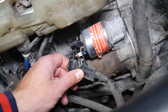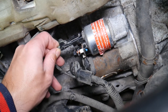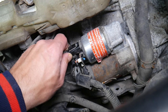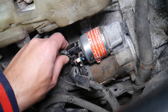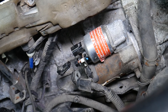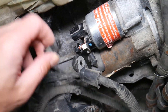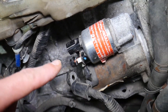The positive wire always carries the same voltage as the car battery. Then there's a second wire — the signal wire or ignition wire. When you turn the ignition switch on, that wire tells the starter to activate. Sometimes that wire will burn, or the clip can break completely from age and fall apart. If you hit a bump, that wire can fall off and cause the starter not to work. Make sure it's plugged in, not broken, and not corroded.